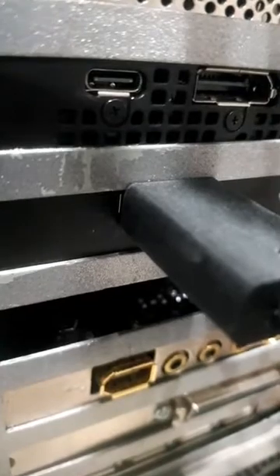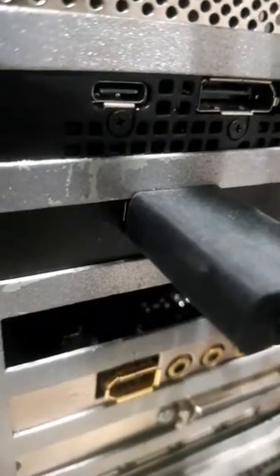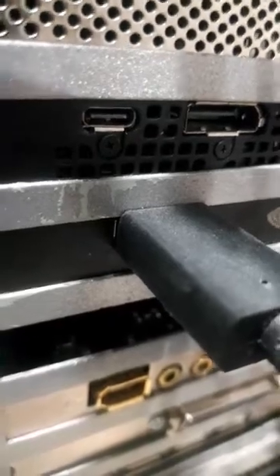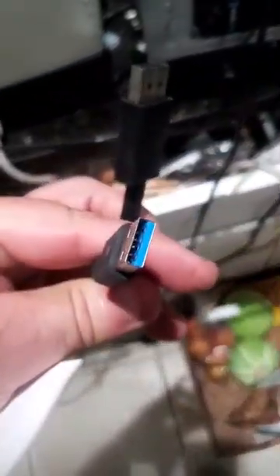The way you can actually get it to work is this tiny little USB port — this is a USB-C. In order for our Oculus device to work, we need a USB-A, which are the connectors that are on this thing here. So we've got the DisplayPort and we got a USB 3. Note the color — that's the big deal. That's what separates USB 2 from USB 3.